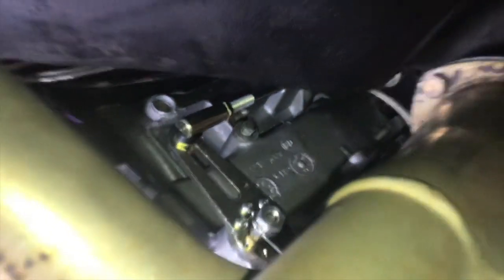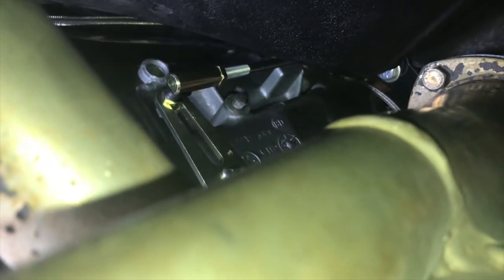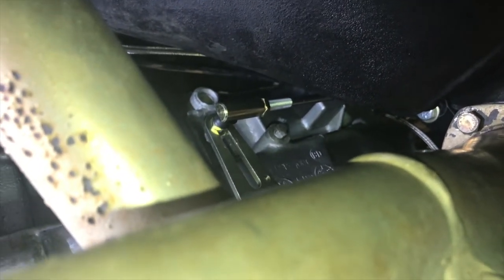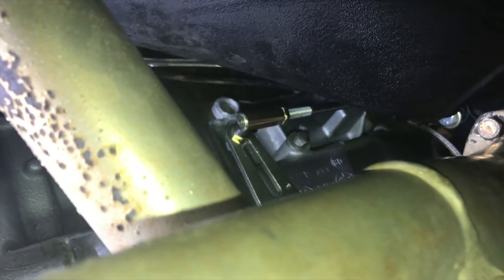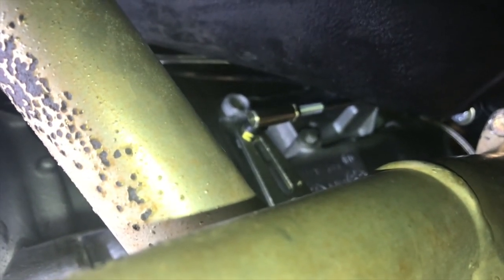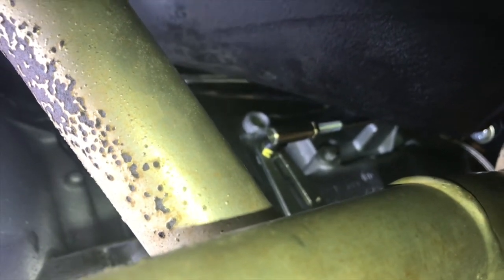Along the radius length of the arm we have adjustments available, as well as length of rod. Yesterday I was up in the vehicle and Nick was checking the shift point detent locations as I was going through the shifter. Everything from park, reverse, neutral, overdrive - all hitting dead on with the pointer on the shifter, and it felt good.